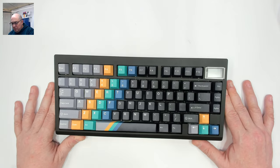I have not heard but one story, that I was involved in, that I talked to the person, that they actually popped out a socket. So that is one thing. Most of the time when PET mods are used, they are already cut out, not only for the switches, but the pins. Now, the IXPE layer that is above it does seem to have slots for where the holes are supposed to be, so that shouldn't be an issue.